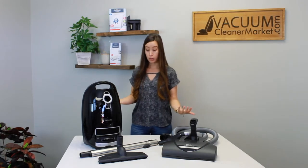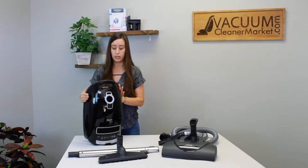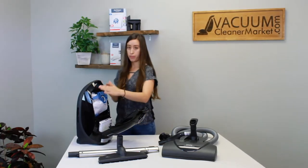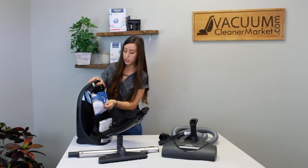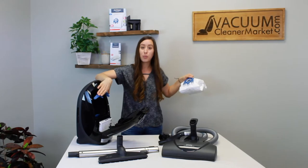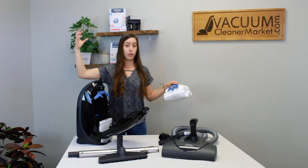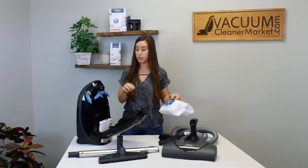Now I'm going to walk you through your bags and filters. To open the body of your canister, angle it down, pinch the little lever, and pull away from you — that opens the canister body. Inside is your bag and your bag clip. The clip stays inside your vacuum at all times; it's what holds your bag in place. To take your bag out, wiggle it and pull it down — the collar comes out, but the clip stays in. This is our biggest replacement issue: people pull the whole thing out and have to replace the bag clip. So save the money — keep the clip in. All debris goes from your flooring attachment through your hose straight into your bag, then through the full filtration process.